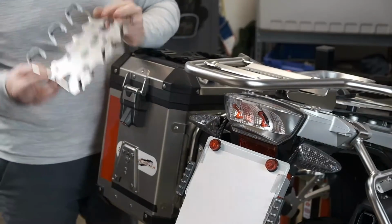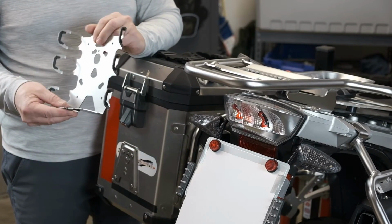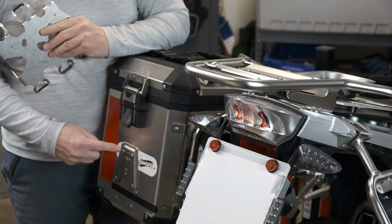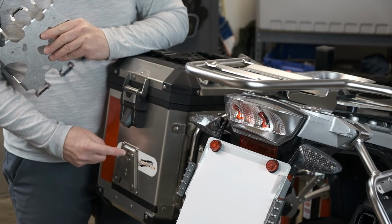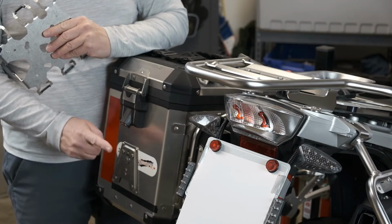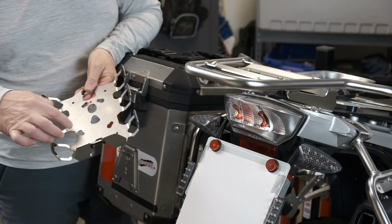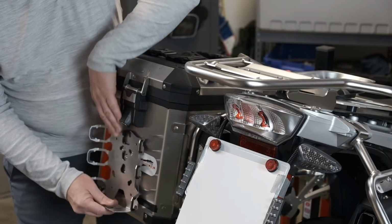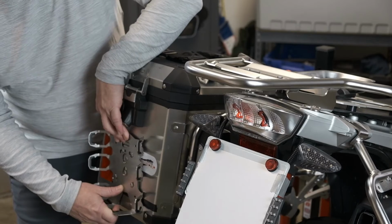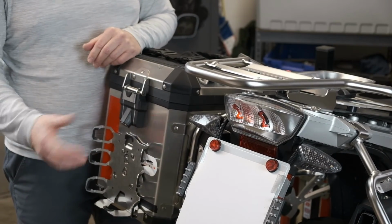Now we take the water bottle bracket and we're going to put it on the adapter. A couple of things to note, and I was mistaken earlier. That 5th bolt that came with the kit, the hex head number 3 that goes in this hole, doesn't go in quite yet, and I'll explain to you in a moment why. First of all, there are 4 holes there that you need to line up, a bit on an angle, gently press in, snap to the right, and it's locked into place.